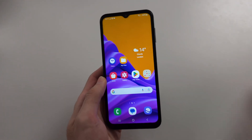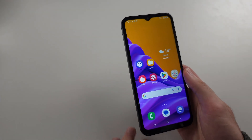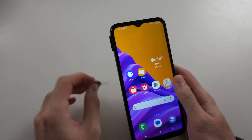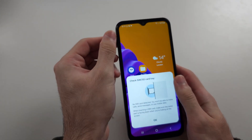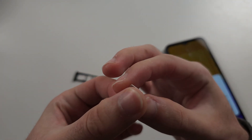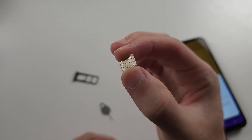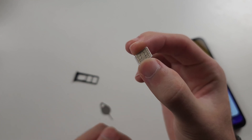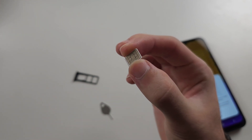If it's still not working and it's your SIM card at fault, the SIM card may need a little clean. So we'll just remove the SIM card from the phone. We want to look at the yellow contacts here. If this contact isn't clean, then the phone can't read the SIM card information, which is why your internet may not be working. So we're just going to get our T-shirt, jumper, or microfiber cloth for your glasses, and just give this a good rub. Make sure this is nice and clean.